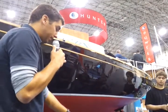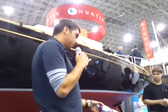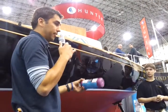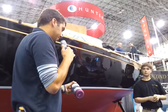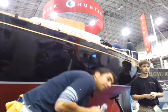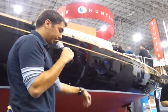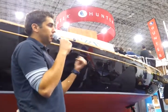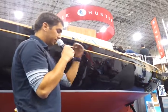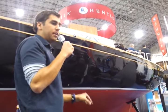These products, especially the 3M ones, Imperial came out because the old Perfect-It has too much benzene in it. They have problems shipping it in Michigan, for one. California, I don't think they're even allowed to sell the stuff. But it is a professional-grade product. You never used 3M? Yes, 3M also. So we're using the Perfect-It and the Imperial products. Finesse-it and Perfect-It, Finesse-it, and I believe there's one more I can't think of right now. Those are abrasives in the same grit range. They're much cheaper. They're not diminishing abrasives.